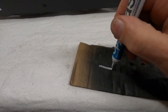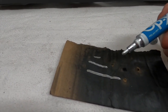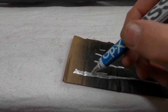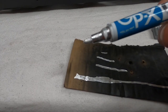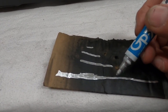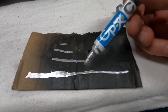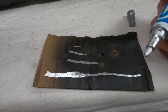See how that's rounded? You can do a pretty heavy line right there, but it's not wide enough for what I need to do and you can see it's almost dry. So what I did was I went the full length, then had to come back and do the full length again, and then again. Then I had to fill in any little nicks. What happened - and you can see it happening here already - is this paint reacts with itself. It's xylene. Once it's dry from painting it on, if you go over it again it wrinkles up as if you put paint stripper on that paint.